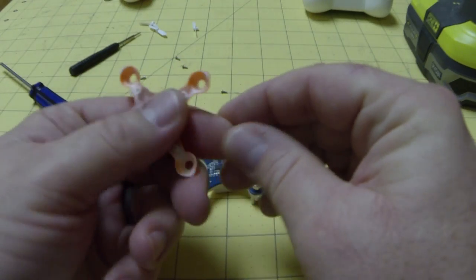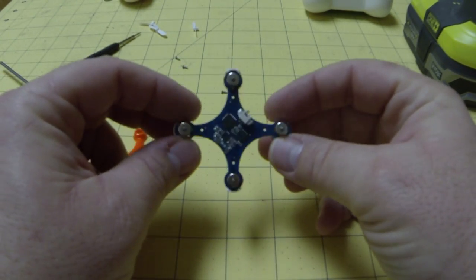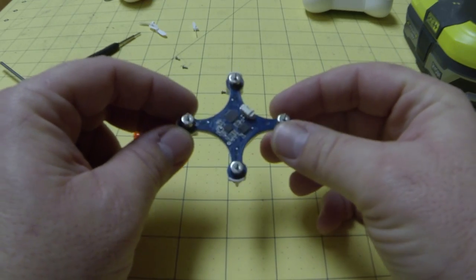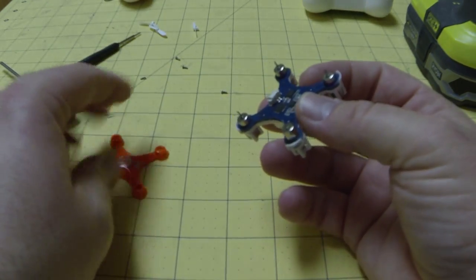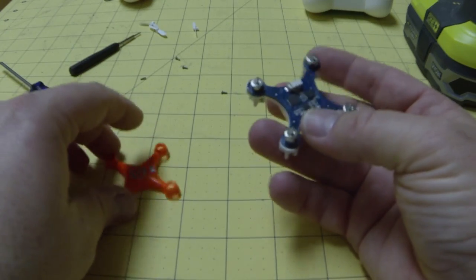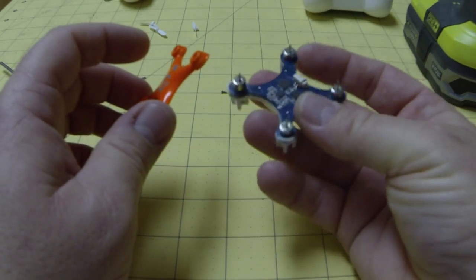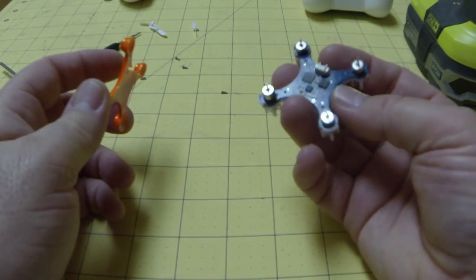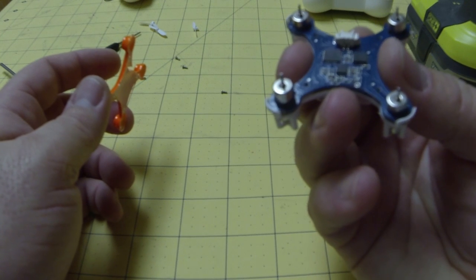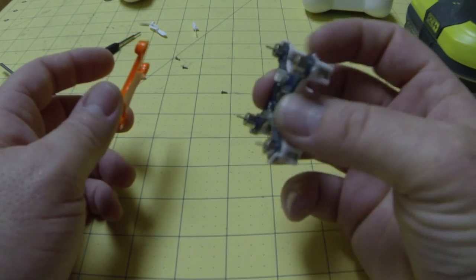This is the blue board. There are three boards — there's a green, a red, and a blue. I believe the red is capable of binding with the Devo deviation series controllers. The green is not — I don't know of anything it binds with. The green has an external antenna. The blue board — I'm not really able to locate it, but there's a PCB antenna on there.